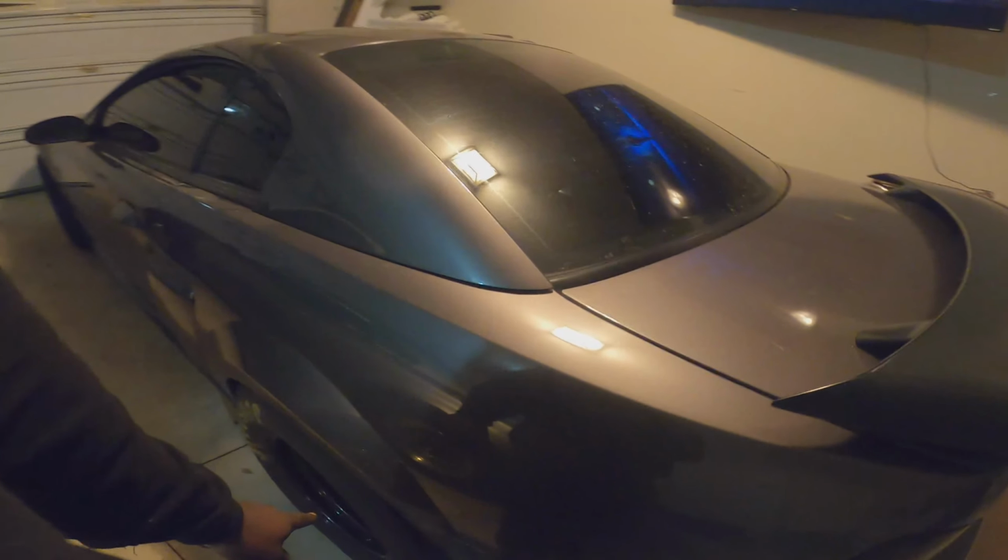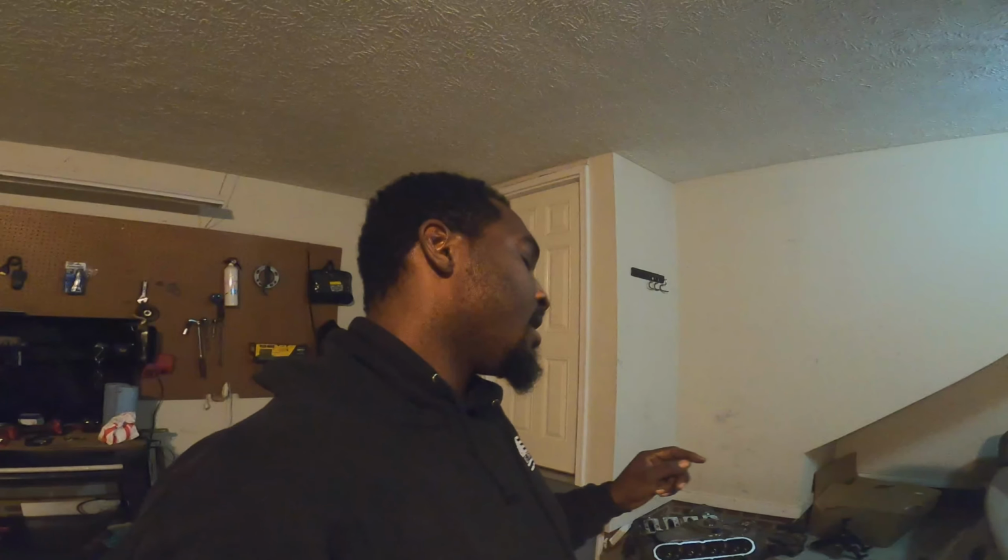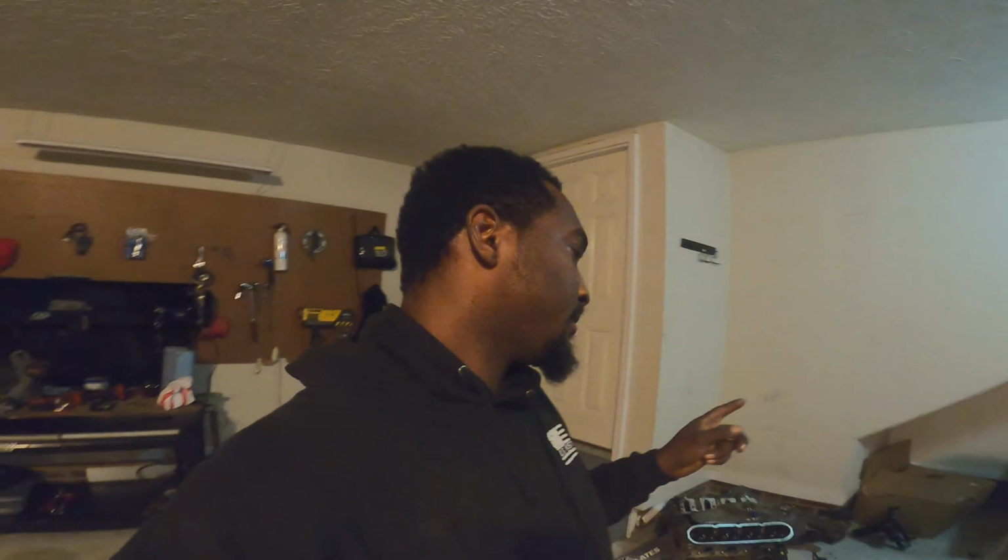It's a no prep event, so that's why I have slicks on the car. I was supposed to dig race my buddy Danny on the street, but at the same time, that's when I found out that the torque converter was the main issue of why this motor failed. It really didn't fail, not like 10 psi oil pressure out of the car. It still idled at like 25 or 29 PSI and it drove at like 40. And when you got on it, it'll build oil pressure, but it wasn't building oil pressure to where it was before I realized that the oil pressure was being knocked out.